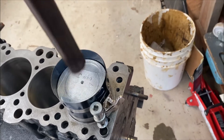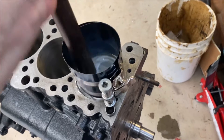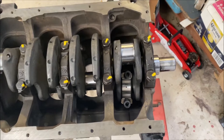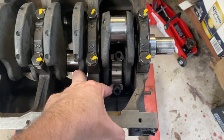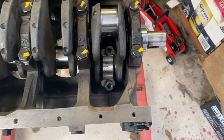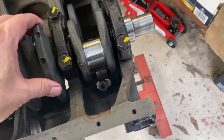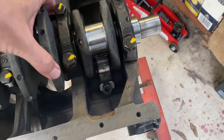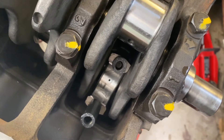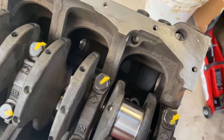Just start to work it down. When it gets close to where the rings are, give it a nice firm push. As you can see on the flip side, this one's slightly twisted — it's just a matter of getting in there and making sure it's nice and straight in that dimension. Note that you cannot rotate the crankshaft around to meet the rod if it's too far out to the side. Make sure you've got your engine paste on, and then push the piston up from the underside, making sure that it's in line with the crank.